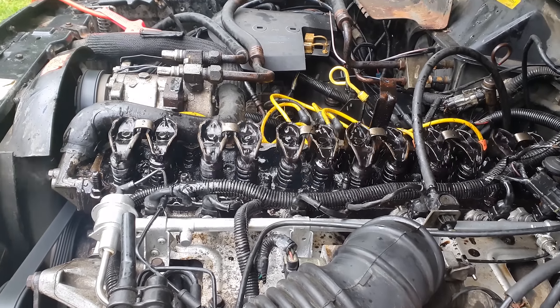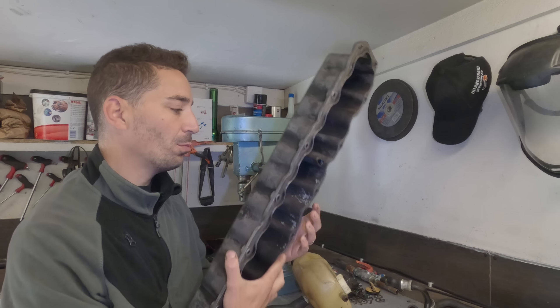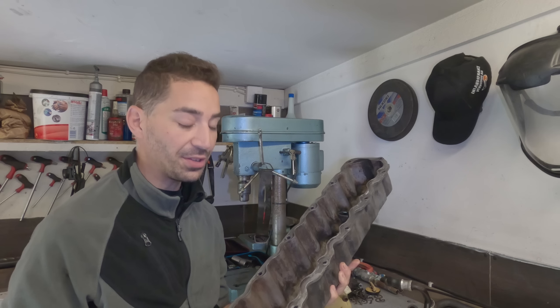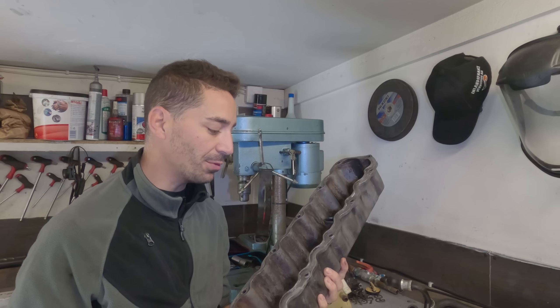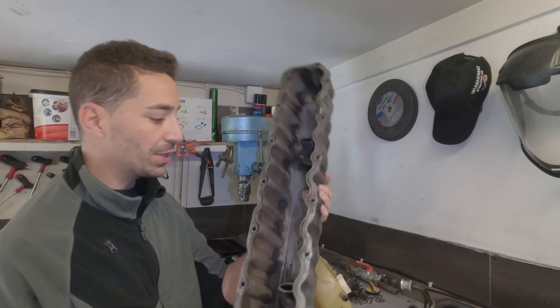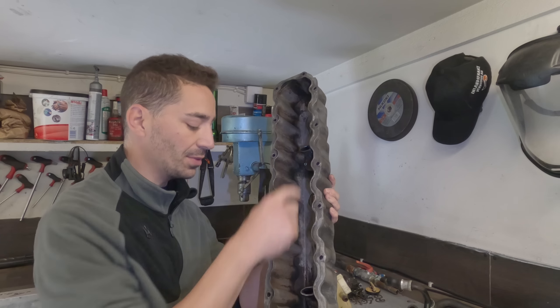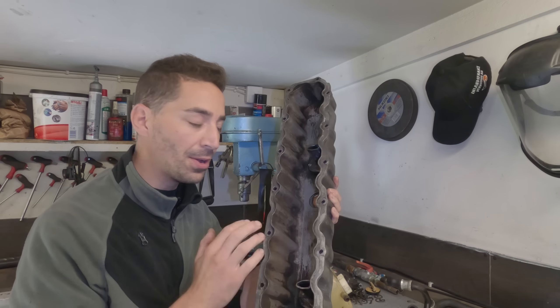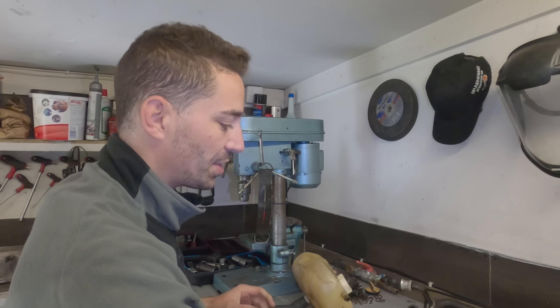Well, that is a relief. That engine is sounding a hell of a lot better than it did when I first started the vehicle up. If you hadn't already heard that — that's what it sounded like on first startup — and I wasn't sure what to make of it. Everybody was sort of mentioning this flex plate, and I was thinking, well, I hope it is that, because it's a lot of noise. And it was the flex plate. There is still a little bit of a tick, but I think that's just the lifters. It could be something like an idler pulley or a bearing. It can be anything really, but nothing's coming from the bottom of the engine, so hopefully nothing serious.